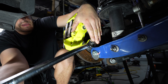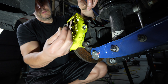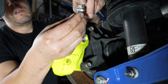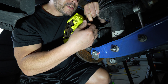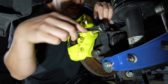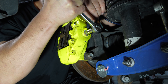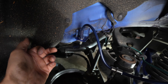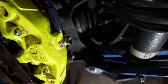Torque to factory spec - don't over tighten them, you're going into aluminum, just remember that. Make sure you put a copper crush washer on either side. I like the copper because it won't corrode and it'll hold up longer over time. Just be careful with the banjo bolt - keep in mind you're going into aluminum. Snug this down - you don't need a lot of pressure, it's like 12 to 14 foot pounds. Everything is together, lines are in, everything's connected just like factory. Both copper crush washers are on.